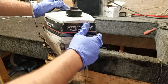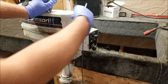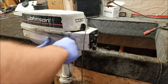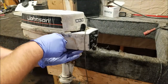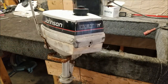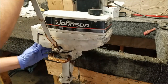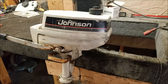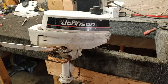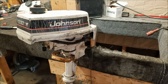There should be a screw back here that you can undo to drop the lower cover. It's missing, which I find is common on every one of these things. The bottom cowl is held in with two clips, one on each side. There's this little slot here — I think somebody added this, probably to get to the clips, because they do a pretty good job of holding the bottom on. I'm going to pull the handle off instead. Alright, the bottom cowls are off now, so that's good.